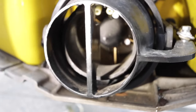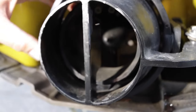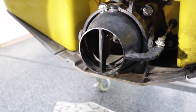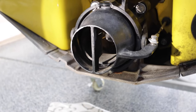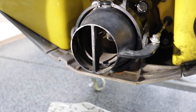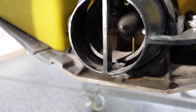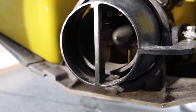The next item, jet-pump-wise, is the oil inside your jet pump. You remove the cone and then remove the entire bolt system holding on your nozzle assembly — three 8mm bolts — and it takes 75-weight oil. I do it every single winter because if the ski is sitting on a dock, water can seep in there, and I don't want any water in my bearings or for it to freeze. It takes maybe 20 minutes and costs about $7. Actually, that $7 bottle of 75-weight will change the jet pump oil probably 10 times. If you're putting the ski away and want to do it right, change it.